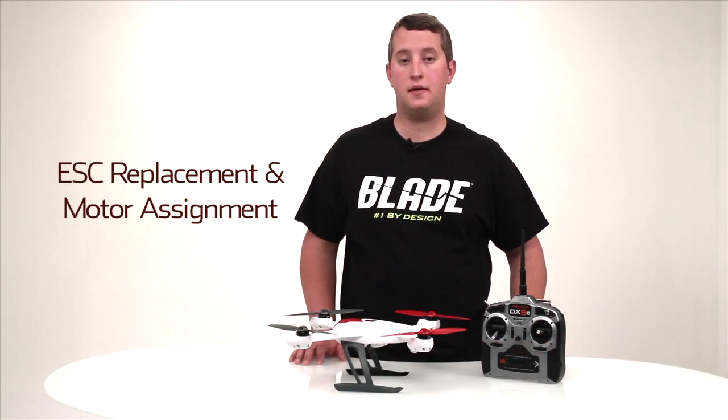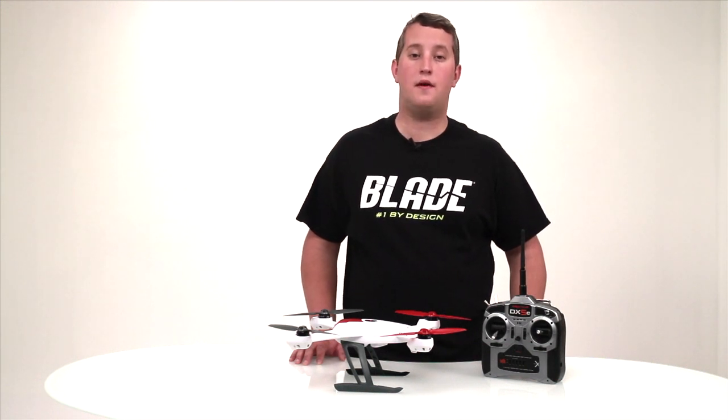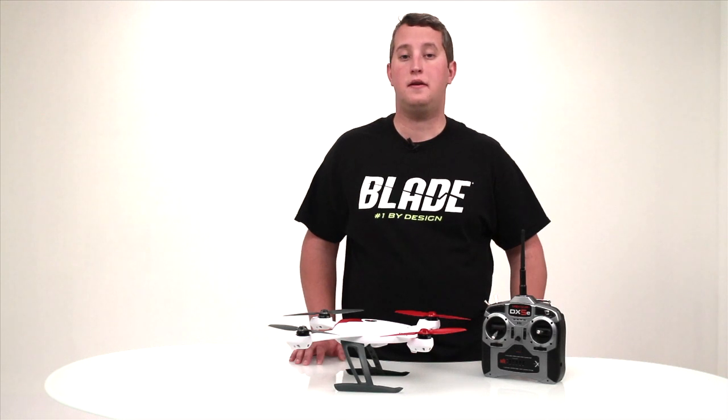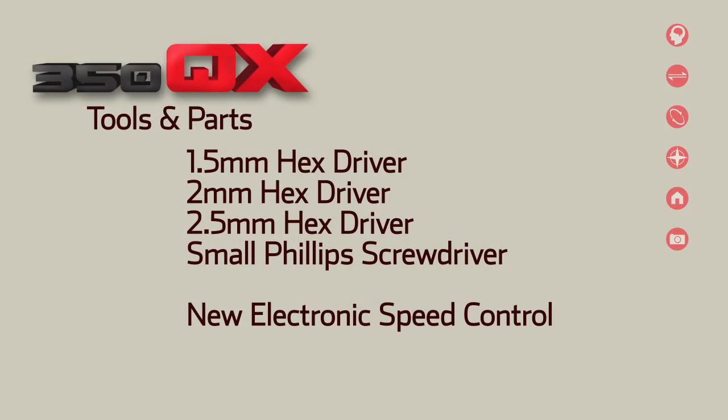In this video, we're going to cover electronic speed control replacement and motor assignment. This kind of maintenance is going to be important if you have a serious crash or incident that either damages or destroys the ESC. You are going to need a 1.5, 2mm, 2.5mm hex driver, a small Phillips head screwdriver, and a new ESC for this job.